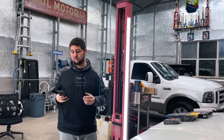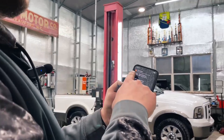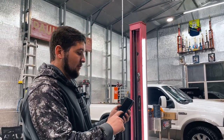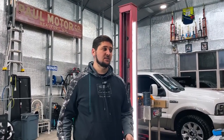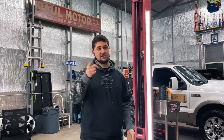Next morning, I pull up the app from my house. As you can see, it sends a notification: Toyota ignition has been turned off. The Drone app tells you everything that happens straight to your phone. Basically the next morning I come out and I can remote start it. If you don't do the reservation mode on these manuals, it will not remote start — that's required for manual transmissions. If you have an automatic, you can get around that. That's how I got remote start on here. If you guys have any questions, feel free to ask, but it is possible on a TDI swap. See you guys next time.